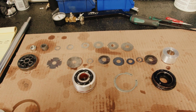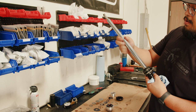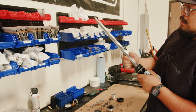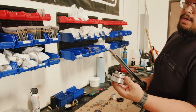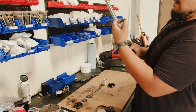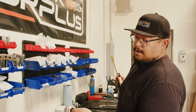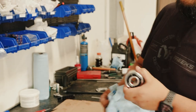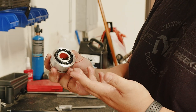At this point I'm going to look at the shock shaft and inspect it for any pitting or burrs — you want your shock shaft to be nice and smooth. Any burrs will cause rips and tears on your seals as the shaft goes through travel. The burrs will cut up the inside of your seal head and your oil seals. This seal head assembly is your main assembly that keeps all the shock fluid in your shock.